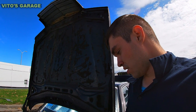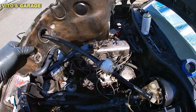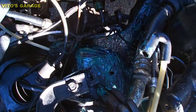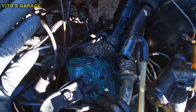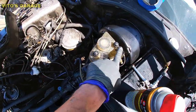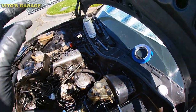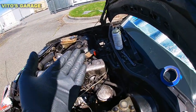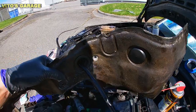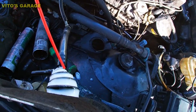I just decided to remove everything — the master cylinder first and the brake booster, just kind of separated them. Before putting this part back on, there are some rubber grommets that need to be conditioned and lubricated. I put some heavier duty grease this time. Everything else is good — vacuum brake booster, brake master cylinder, brake fluid level connectors — all that stuff is reconnected and the wiring harness is all reattached nicely. There's a vacuum reservoir on that side with a line that comes to it — that's also reconnected.